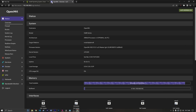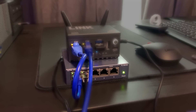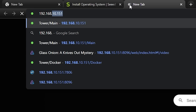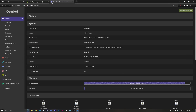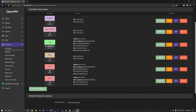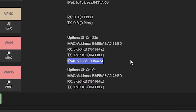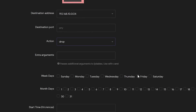To get started, I just downloaded the release they provide, which uses OpenWRT as well as LuCI — I believe that's how it's pronounced — which is the web user interface for managing OpenWRT. After flashing it to an SD card with Balena Etcher, I ran a cable from my local network to ETH0, which is the WAN port by default, and then connected ETH1 to a small switch so I could connect my desktop and any other devices. After booting it up, I was able to access the web UI at 192.168.100.1 and start setting things up. After basic stuff like setting up a password, I made sure my WAN interface got an IP address from DHCP, and then messed around with the firewall rules just a little bit. I set up a simple rule to block access from my LinkStar LAN to my actual LAN, and it worked as expected.